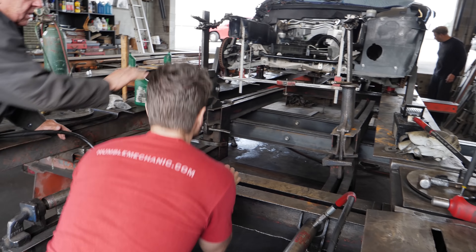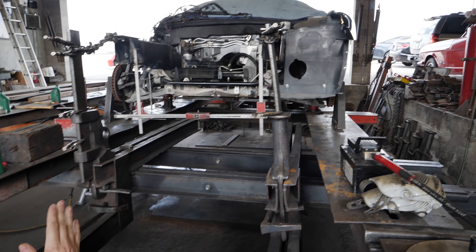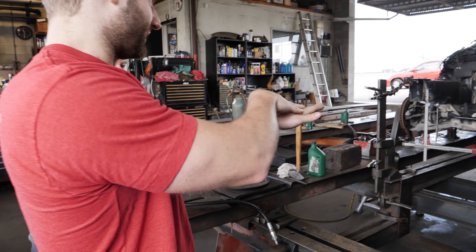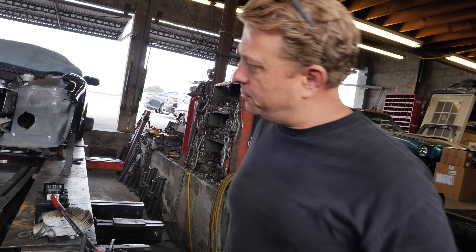Take a look right there — see how far off that gauge is on center line. When this rail comes down, that pin will go this way. So that brings the center line — this thing could be vertically right but then it could be side to side wrong. Correct. That's what our little center pin will be. Once we're getting really close to the end, that center pin in the middle of these gauges — all three should line up as one.